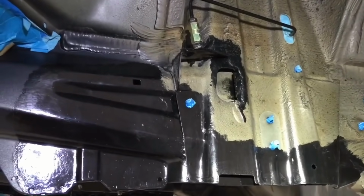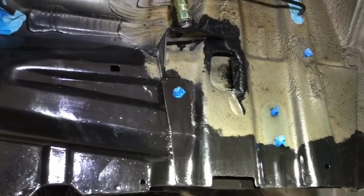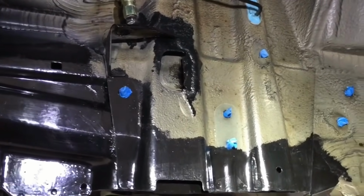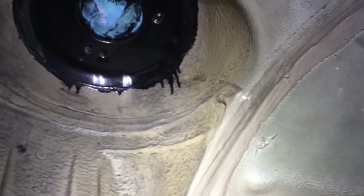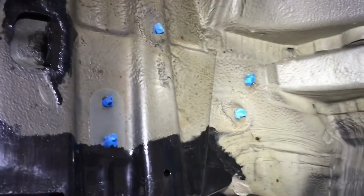This is in the front left of the wheel arch of the CSL. You can see where we've done the POR-15 work on the corroded areas, once after taking the corrosion away and treating those. And we're now just going through the process of masking all these little holes where we know that paint spray could go through, up into the turret there, before we do our paint spray.